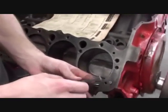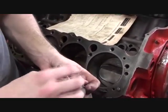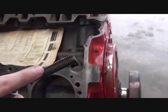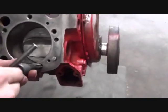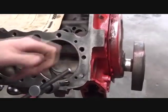You need to clean the bolt holes free of any debris, grime, or thread sealer from before. To do that you use a re-threader device — these little grooves allow the dirt to escape as you turn it in. You stick it in and turn it all the way down.